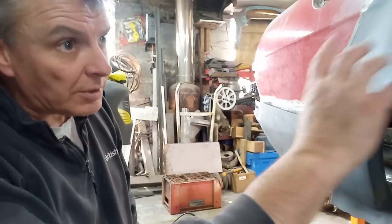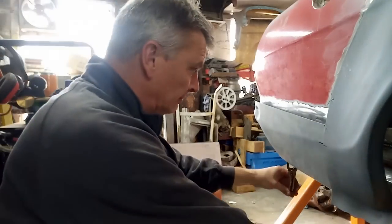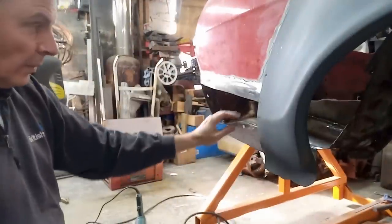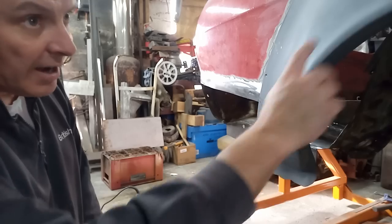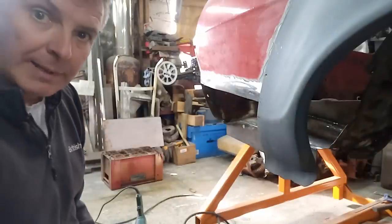We've got as far as cutting out and preparing the outer skin and the inner arch, and we've got the repair done in here. So we've got that repair done. So that's a good step forward. So I think the next video will concentrate on getting the inner arch tubbed out to the outer arch, and possibly get this rear quarter fitted into place.